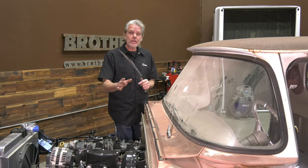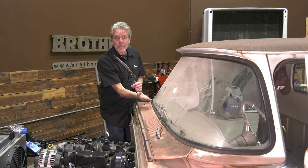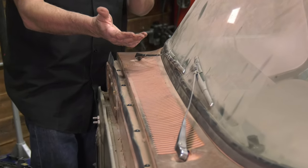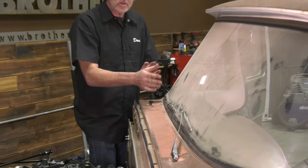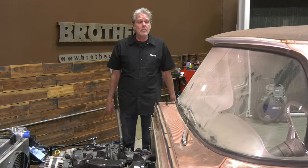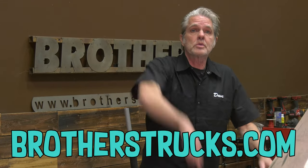We're all done and ready to install the arms. What I like to do is turn the motor on and off a couple of times to make sure it stops in the same place each time, and then go ahead and put the wiper arms on. Still be careful though — sometimes the extra drag from the wiper arms will cause it to stop in a different position and it might scratch your paint. When you turn it on, watch where the blades go, make sure they're not hitting your paint or going out weird, readjust, and you're all set. My name is David Welch, I'm at Brothers Tech Center. Check us out on Facebook, Instagram, and subscribe to the YouTube channel. We'll see you next time.